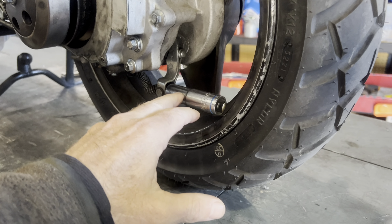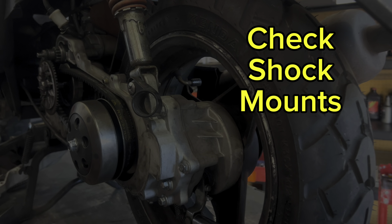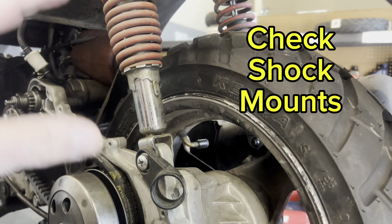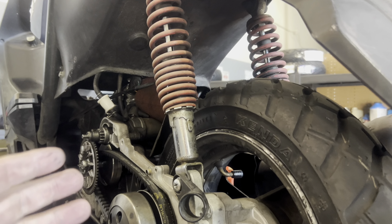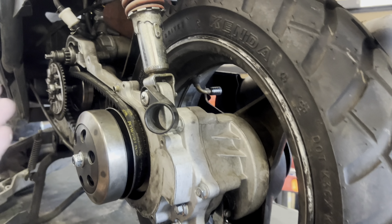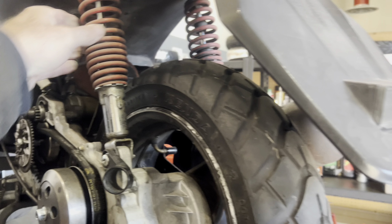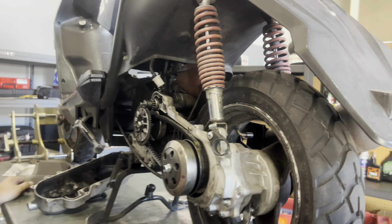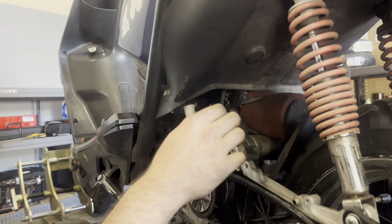This is another area you should inspect. You should also be inspecting your shock mounts — make sure they're tight and make sure your shocks aren't leaking. Adam's Vision has dual shocks; a lot of the 49cc/50cc scooters have a single mono shock, so check your mounts. This is stuff you can DIY at home — it's definitely important and keeps up the condition and performance of your scooter.